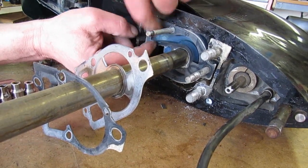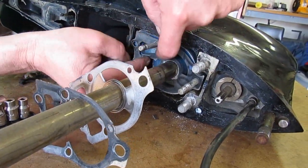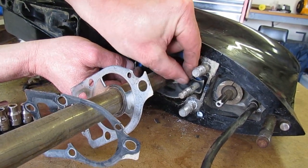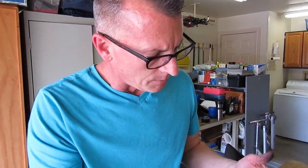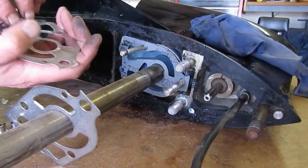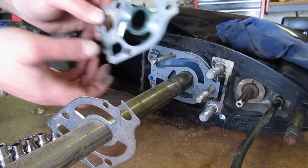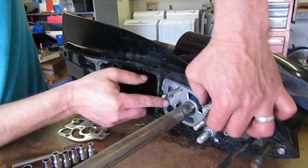The kit comes with all the replacement gaskets. The last one underneath is going to tear as soon as I try to get it off because it's really on there tight — and yes, it broke, just the way it is; it's old, has a lot of water around it. You want to make sure you get these gaskets oriented correctly. Here's the order: first the soft gasket, then the metal one — this little tab that sticks up needs to go on like that — then the last material gasket goes on.